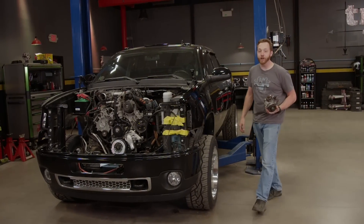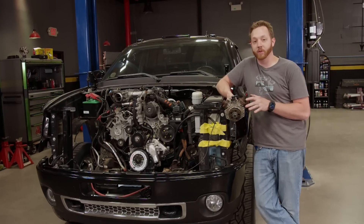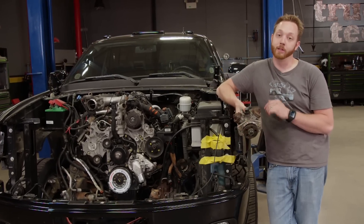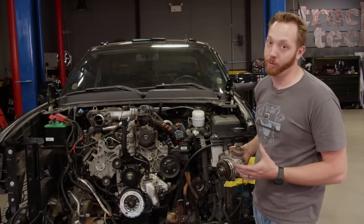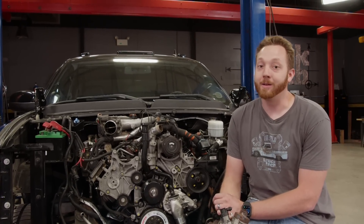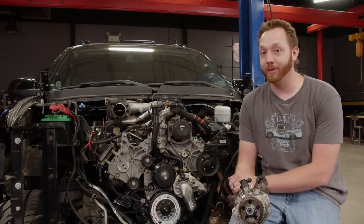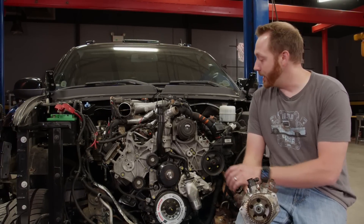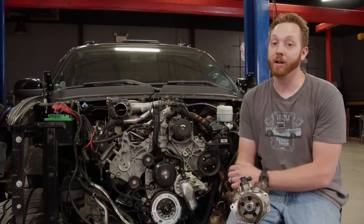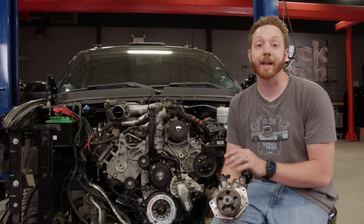The LML Duramax was used between 2011 and 2016, and at its heart was a Bosch CP4 injection pump. This is a pretty high-tech piece of equipment and is much different from the earlier CP3 used between 2001 and 2010 — mainly because it's a two-piston design. This pump will also operate at a much higher pressure than the older ones, which means you can atomize the fuel into a much smaller droplet, meaning more complete combustion and reduced emissions output. However, the CP4 does have a weak link — it is known to prematurely fail. When it does, it's going to take out the rest of your fuel system, including those very expensive injectors. We already have a brand new CP4 bolted down into the valley, and when we installed our FASS lift pump some time ago, we gave it an extra layer of protection because the FASS will remove any air and water from the fuel and increase its lubricating properties, which will help this pump live a long and happy life.